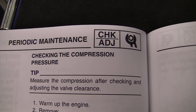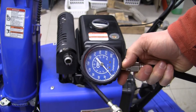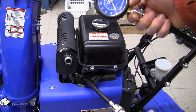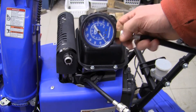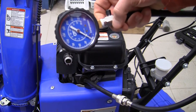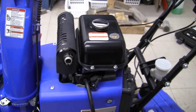Good news — it's the first manual I've ever seen describe the compression test. So here we are, I'll put my OTC compression tester in there. I've never compression tested a four-stroke engine to be real honest with you, but it's written in the book, so let's give it a try. I've got the fuel off, I'll put the throttle to the fast position so the carburetor should be fully open, and we'll crank it a pile and see where it goes.